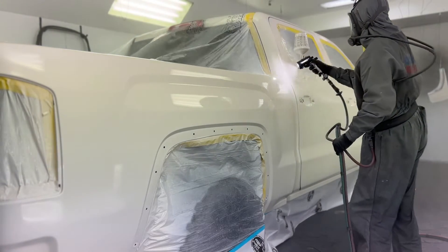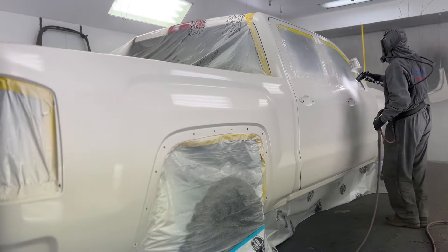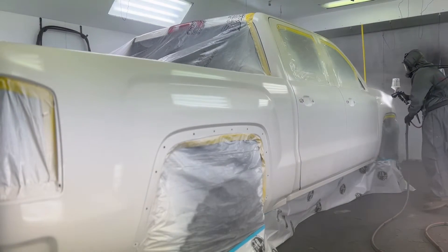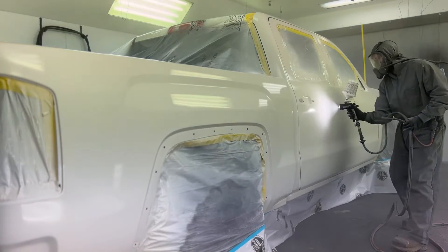White is just thin. It's a very thin product on any paint line, especially solvent-borne paint — it's just a lot thinner than most. Under-reduce it and you should not have any issues with that. It'll cover a lot better. Put it on nice and wet.